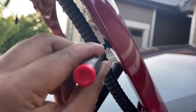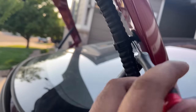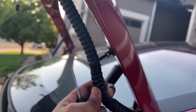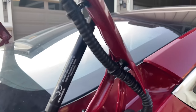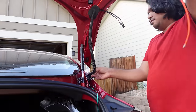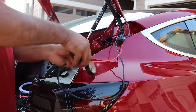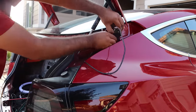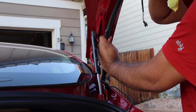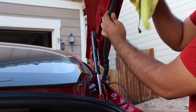To make this routing process easier, we are going to remove the zip ties. Insert a very small flat head screwdriver through the opening slit on the zip ties securing the grommet, then remove the zip ties completely to allow the grommet to become loose. Do this on both the top and bottom zip ties. Then insert a fishing wire from the top and allow it to reach the bottom grommet. You may use some WD-40 to make this process easier. Put electrical tape on the camera plug, secure it using the fishing wire, and pull the fishing wire from the top. This is a tedious process so be really careful to not pull on any of the Tesla wires.